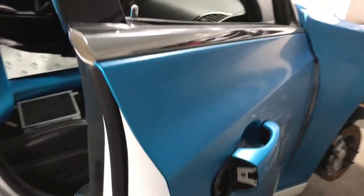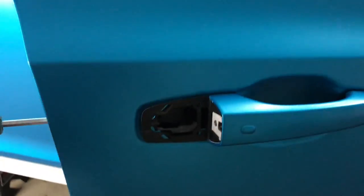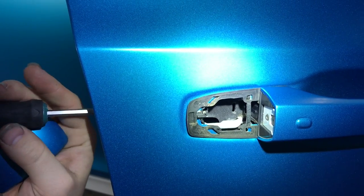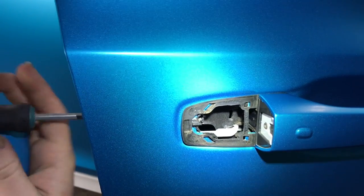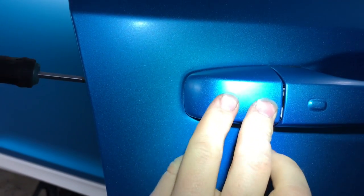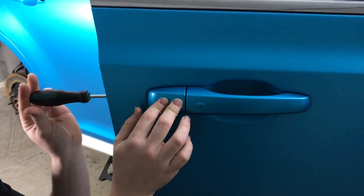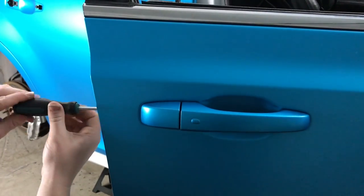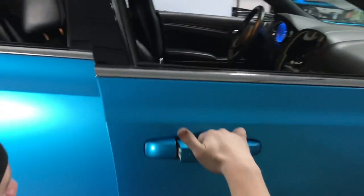So now we reverse this Torx. Oh, so this is the slider that I told you the Torx moves. So you see how this is clockwise. This is tightening it, puts it this way, which will lock in this. Counterclockwise moves it back towards the front of the car. So counterclockwise releases it. Now we're gonna go clockwise. Righty tighty, until we're snug and we have a door handle.